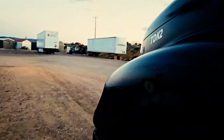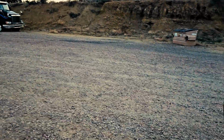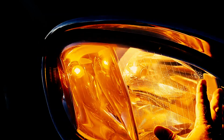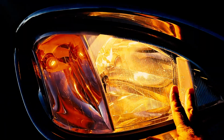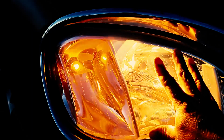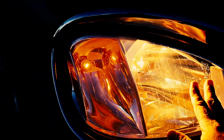And you would do the same inspection on the right side of your vehicle as we did the left. I'll inspect my headlights to make sure they're properly mounted and secured. The lens is neither cracked, damaged, nor loose. The lens is clean and clear, proper color, clear.